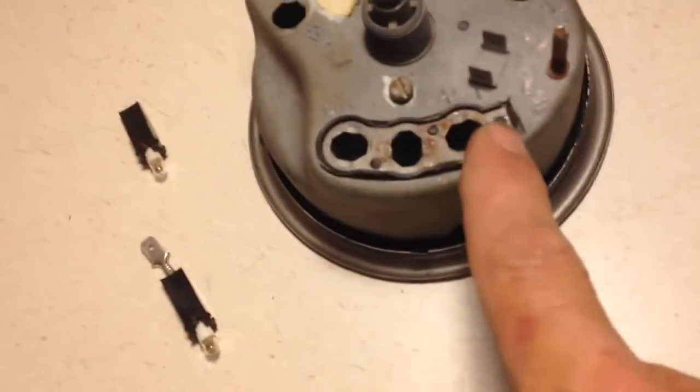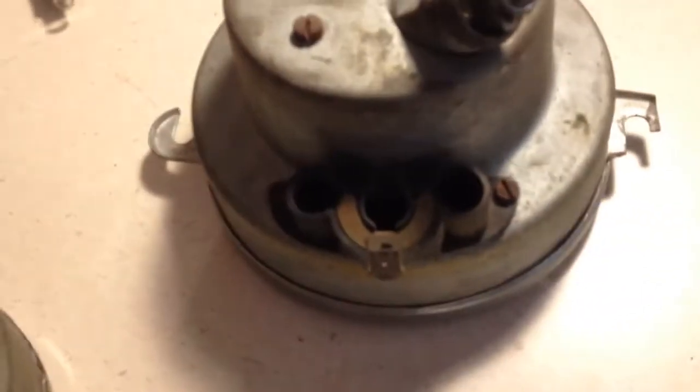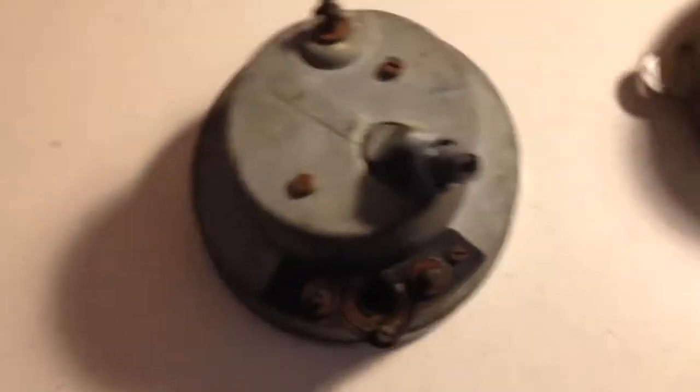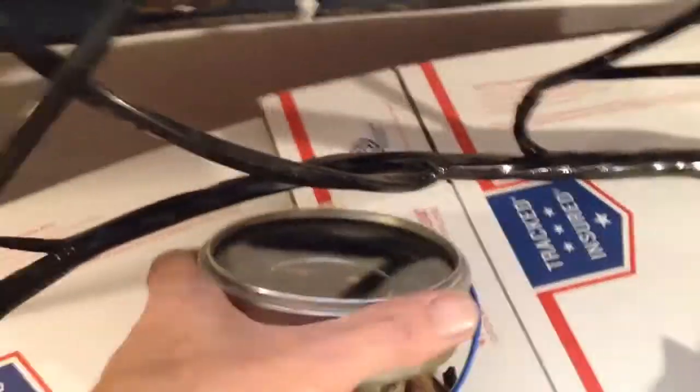Now, this one's a little different, but on all Beetles they're more or less exactly the same with this little Bakelite rig down at the bottom. The old ones are screwed in, so you can take them out and put fresh gel lenses in to make it all happy and pretty. I'm going to come over here to the 68 one that we're wiring up into this dash. Since it's got a fuel gauge, it'll give us a little extra options, because it's the same except for those two wires.